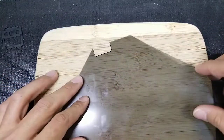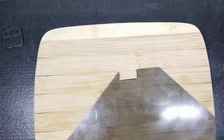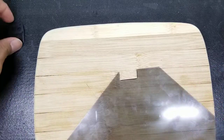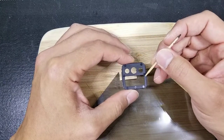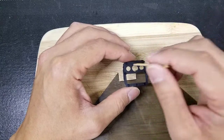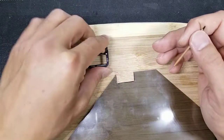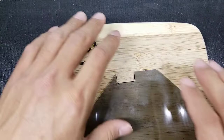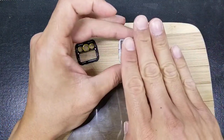The other two types are adhesive and non-adhesive. Non-adhesive is self-explanatory — you just get a filter, cut it to the right shape and orientation. What I like to do with those is put a little bit of glue around the border or perimeter, then press-fit the filter into the masking and put the masking on top of the watch unit. Because we're using an adhesive filter, I'm actually going to be putting the sticky side directly onto the display itself — in this case just the lower half of the display.